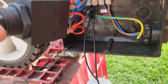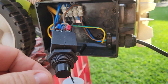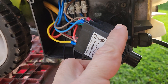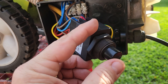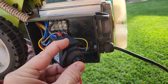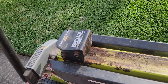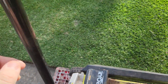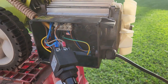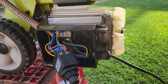I have attached the capacitor and I've just left it dangling here because we're going to test it out first. This is the switch here and we're just going to test it out, being very mindful of where my fingers are placed. Feel free to put how unsafe I am in the comments. Let's turn it on. Very good — I'll check the switch works as well. Excellent! It's turning on instantly — it's doing what the capacitor is meant to do, providing that push the motor needs to start. That's fantastic — problem fixed!